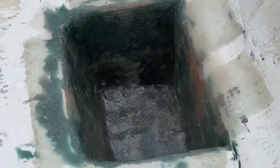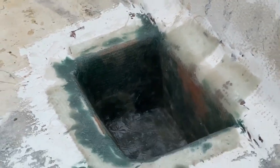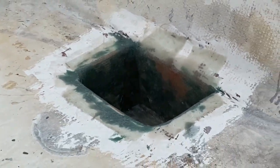As long as the fiberglass has not dried, you can continue to lay up pieces — mix some more resin, cut some more glass, and just keep working on it. Once it dries, you have to sand it and rub it down with acetone before you do it again. This is basically the finished box; I have some sanding to do — all fiberglassed in.